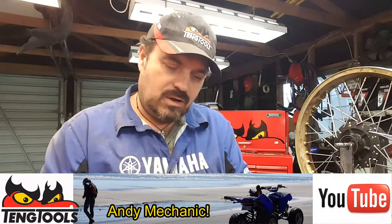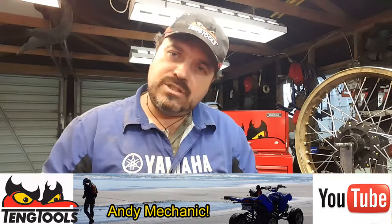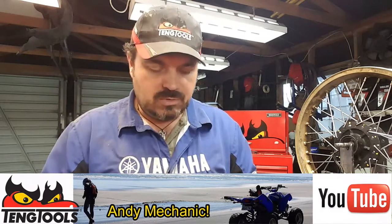Don't forget, you're going to need some thread lock. This stuff is Loctite 263. You're going to need some of that to go on the threads of each of the spokes. Acts as a lubricant as you tighten them up, then when it sets, it stops the spokes coming undone.